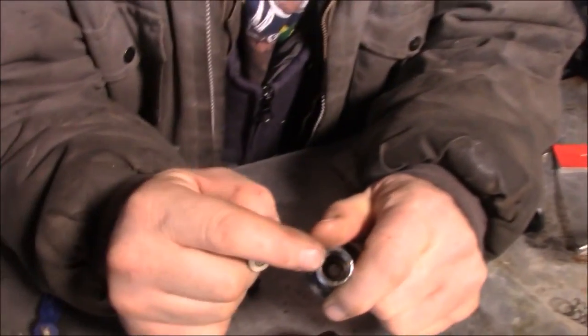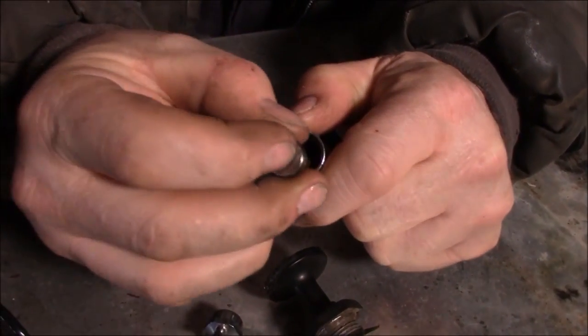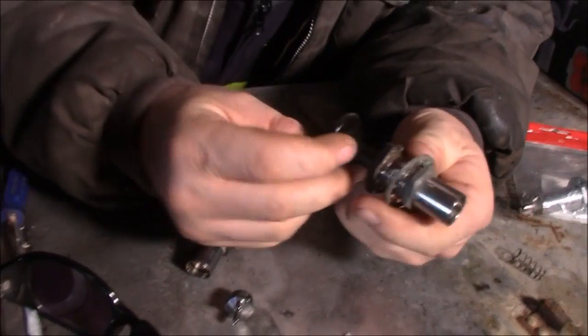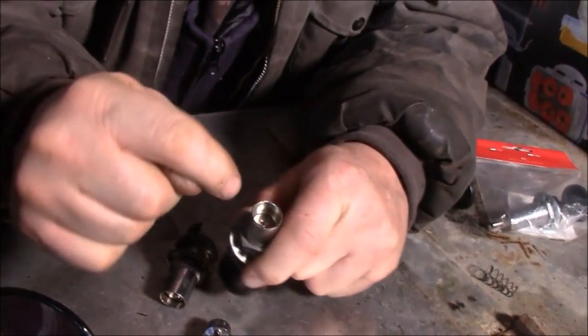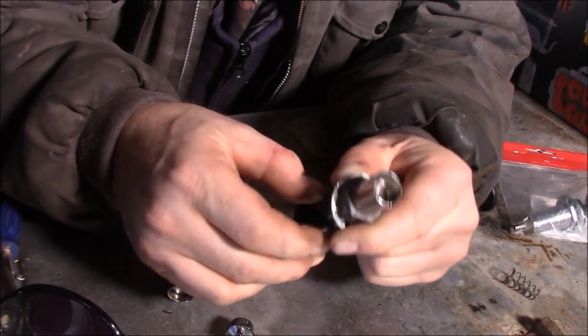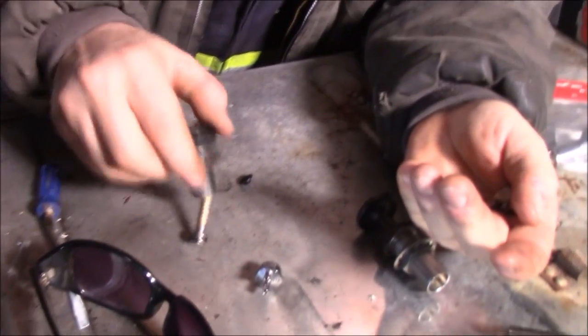So basically what you have inside here is a barrel. It looks like a barrel, and you have an O-ring on this shaft. It just works like a syringe. So that goes through here. So when you pull on this, it draws some fuel inside here like this. And when you push on it, it squirts it through. But I'll show you how the valve setup works on this.